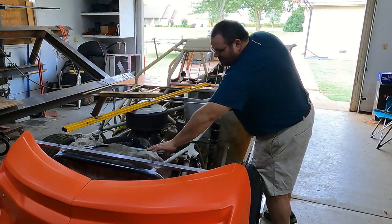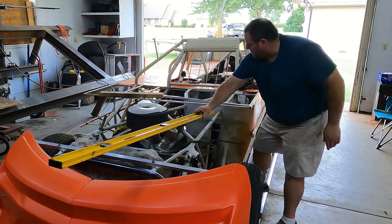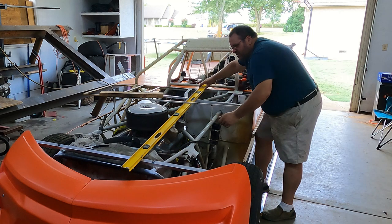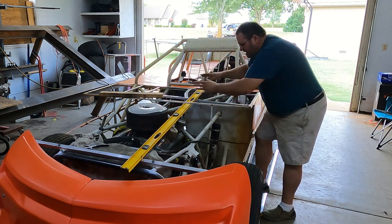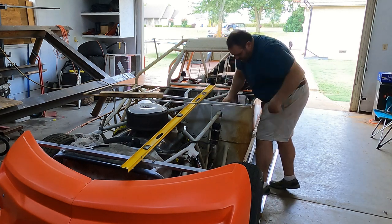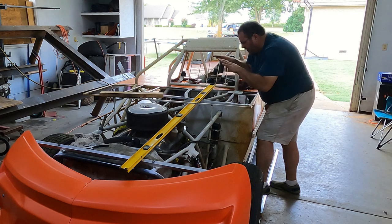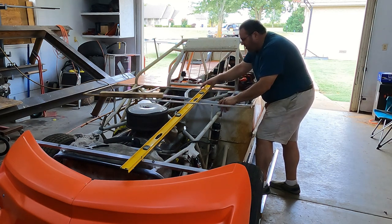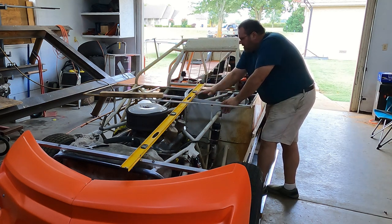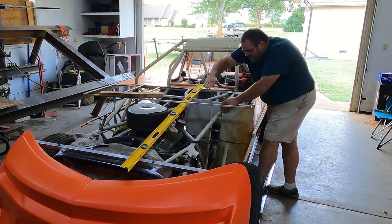I've got them welded up solid, bolted up tight. I've got my straight edge here and I'm under this bracket — this bracket's going to come down too. Right now I'm working on my firewall, and what I was doing is just taking my straight edge. I've got it laying across here, and I've drilled my firewall — it's in two pieces that I've got pop riveted together in the middle. I've drilled all my pop rivets out and I'm lowering it down, trying to get it all the way down to where this is a straight line from my deck all the way down to the hood — a nice smooth line. I'm going to get the firewall done and level, then cut my tabs off, re-weld them, and bring all this front down to match it.